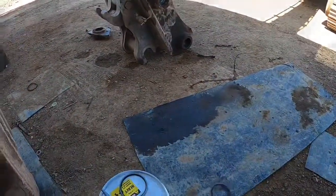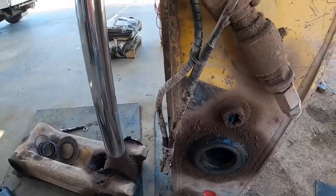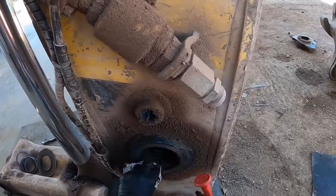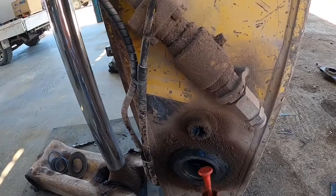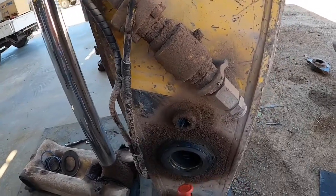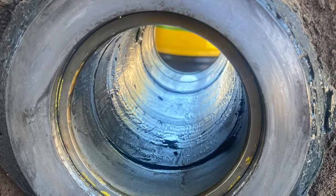When the seal comes out, discard the old seal — we need to clean up the ball. Scrape off as much grease as you can and then finish off with brake cleaner and a rag. We have to get it fairly clean because we're going to use bearing retainer and it needs to be clean to bond to the surface. That first shoulder you see is all we need to clean.